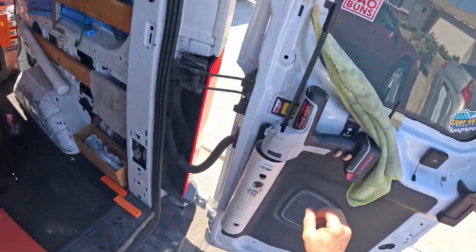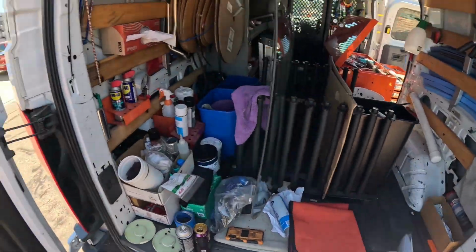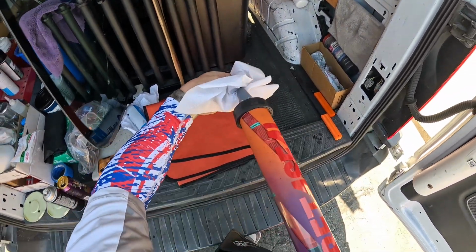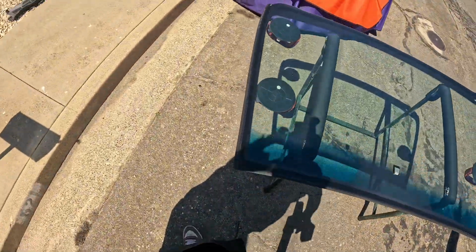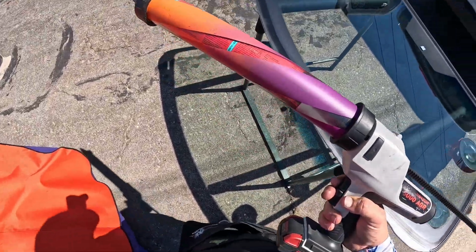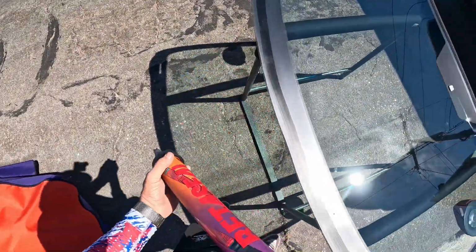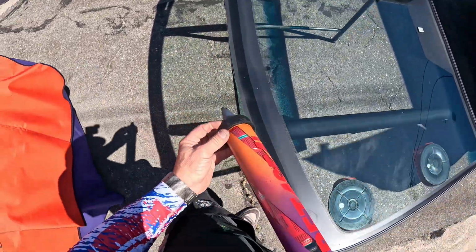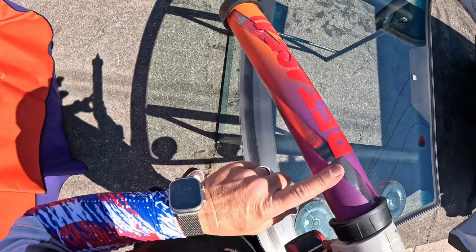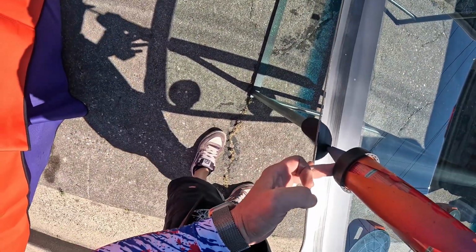And let's shoot some glue. Shooting our glue, we are using our Power Push 6000 by Meritool. Already done little snippets on this guy a few times. Definitely the smoothest running gun that I have had after using the Milwaukee for years. And this I picked up last year from them at the competition at Auto Glass Week, and it will not do the little double clutch thing where the Milwaukee spits out that extra ribbon if you twitch your finger the wrong way. So definitely the smoothest running gun. And fun fact, with their plunger, it actually uses more of the urethane, so you're wasting less urethane if you're using the entire tube.